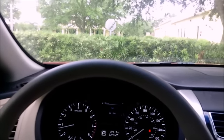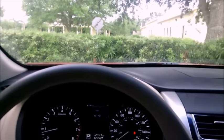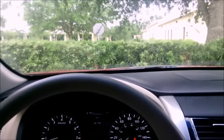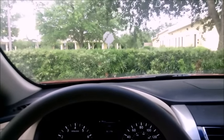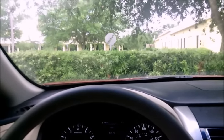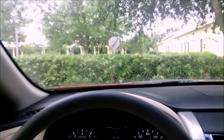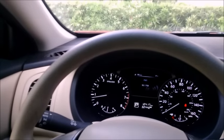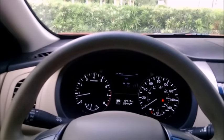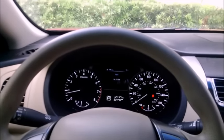You'll also want to turn it off going uphill or downhill. You can also use it when it's snowing or rainy weather where you want a little more control over your vehicle. Normally you'd use overdrive at all times, but sometimes it's a little too sporty with too much variance in speed. With the overdrive off you have more control over your car, your engine, and engine braking.